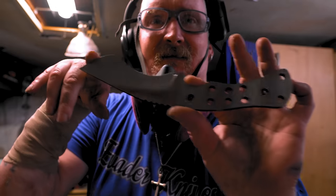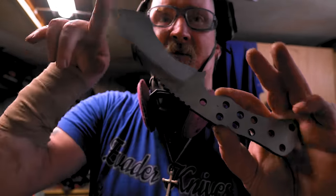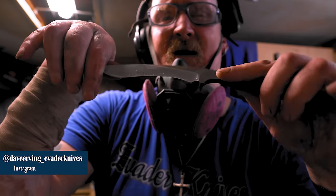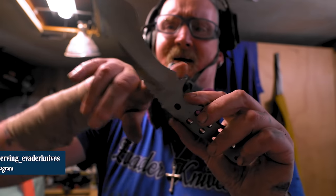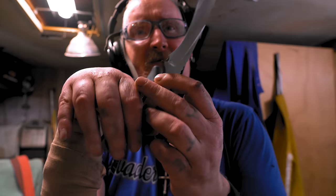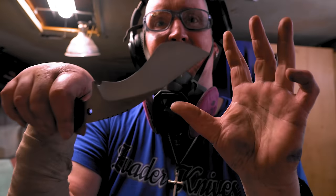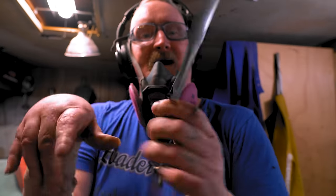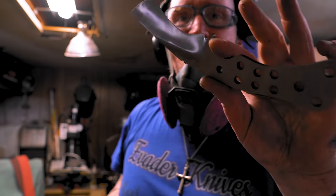So that's about it. I still gotta put the magnet on it and hit it on the flats. I'm just gonna hit the Scotch Brite on the flats. Then the next video, I guess we'll hit it with the Caswell's Black Oxide, or I think I'm going to do the black oxide to make it blacker, because that's what he said, one and two tone. Then we'll take the Scotch Brite and hit these again. I'm just glad I got these bevels. The bevels are done. Other than taking the Scotch Brite to them to clean off the two tone, I'm not touching them again.